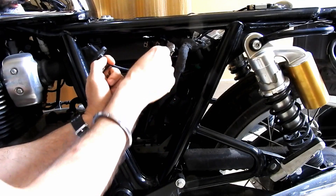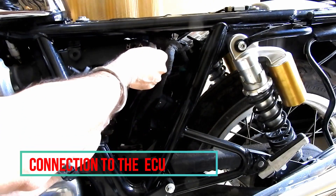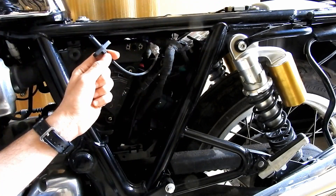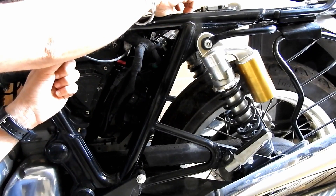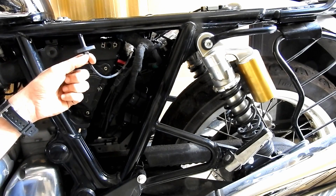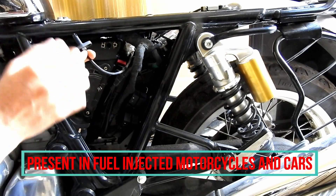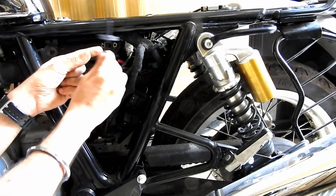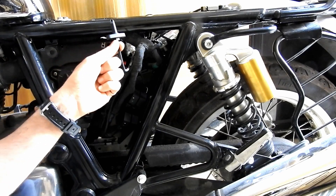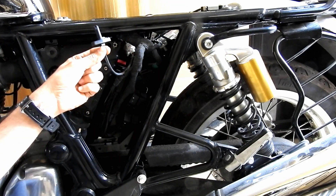You can clearly see this wire going to a white coupler. From there it is connected to the ECU — the metal or aluminum box on top, near where we have our seat. This is the intake air temperature sensor, the IAT sensor. Sometimes there is a MAF sensor — the mass air flow sensor — but nowadays most fuel-injected motorcycles use this IAT sensor. So if you are facing cold start issues, rough idling, or engine stalling when the temperature is too hot, you should first check and clean this sensor. If it is clean, then get your throttle body cleaned or checked.